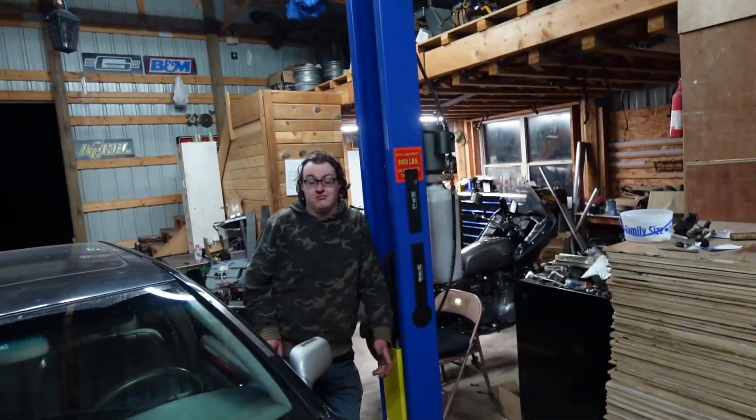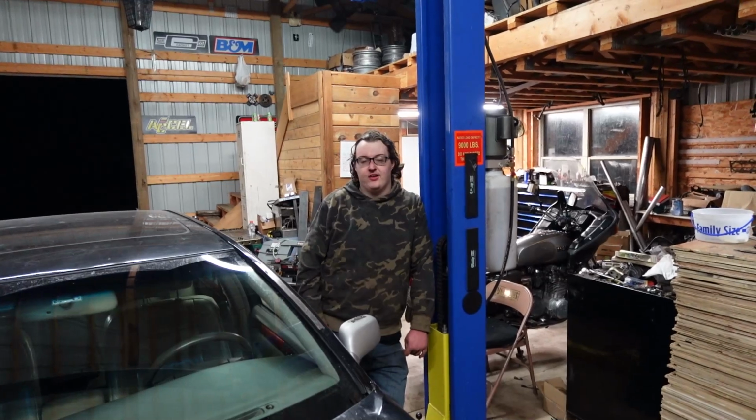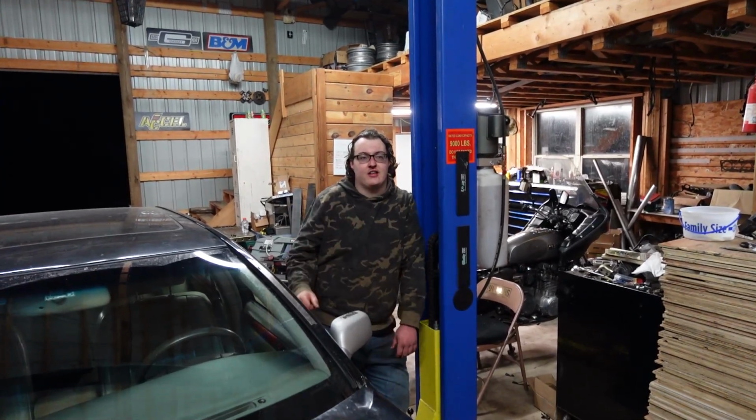Because I can't imagine that if you straight piped it, like I've heard a lot of straight pipe JZs, and I'm not a straight pipe guy, but they don't sound bad. They sound like JZs, right? So I'm not convinced that it's anything but the fact that you either just have two blown out mufflers on it, or there's just a gnarly exhaust leak that's giving it the rasp. I do know that there's an exhaust leak under the center of the car where it meets the factory cat pipe, but I also don't think that the mufflers are dead, and the step down that they have that's welded together. Yeah, that could also be affecting sound, of course.